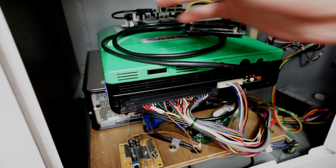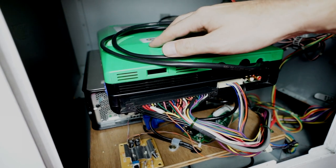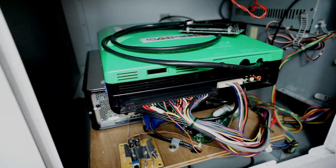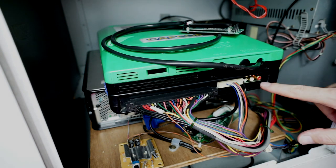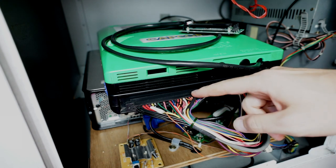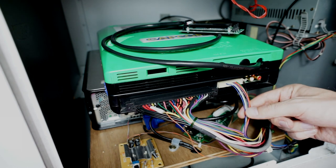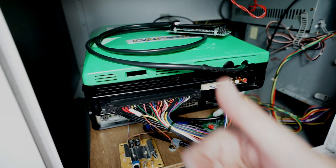Last cabinet — there's lots of stuff going on in this one. We have a CPS2, which is where I showed you Giga Wing running before. If you want to capture from this, same deal — you just connect the same adapter on the Jamma edge that I showed you earlier. The cool thing is you wouldn't even need to solder anything, because the CPS2 has separate audio outputs — it outputs audio separately here on the RCA/chinch connectors. This has nothing to do with the video stuff. There's also a kick harness here for the additional kick buttons.